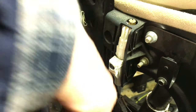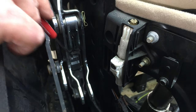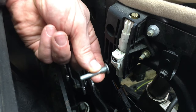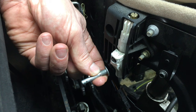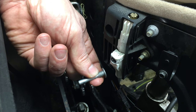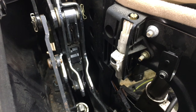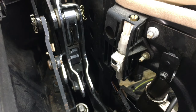The lower mounting pin on the bow extension cylinder — in newer models it's a 6mm pin with a circlip on each side. In older models, 90 through 94, it's actually an allen or torx head pin that gets unscrewed, with access from the inside when the rear bow is all the way down and the top is down.